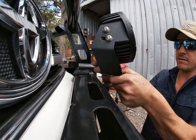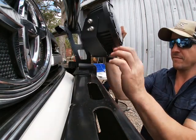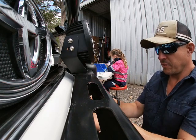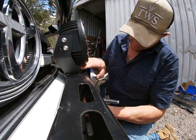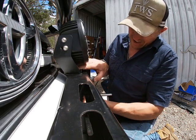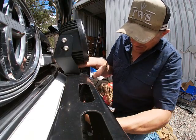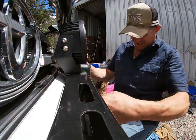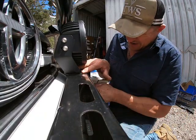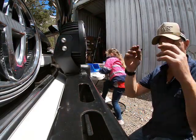Gasket. Alright. Put it right there. We're putting that bolt on the top here, just that bolt on its own, straight down through the hole. We'll pick up our washer and our nut up underneath. Straighten up that gasket. Straight with the gasket. Make sure that nut's captured. Square. Okay, not too tight just now in case we've got to backtrack. Beautiful. Alright.